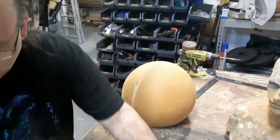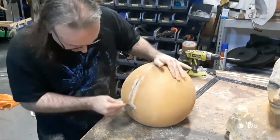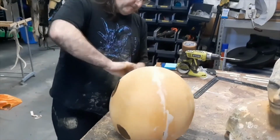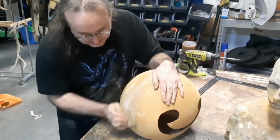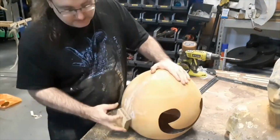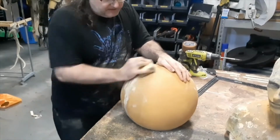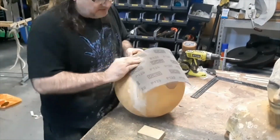You can see there that dark mark is just the original plastic showing through as we've gone through all the paint and filler. So we know we're pretty much as far down as we want to go there, so we need to build up around the other side of that. So again, mixed up some body filler, smooth it on, and work through it again with different grades of sanding sponge and a mesh sander.